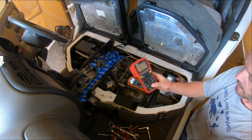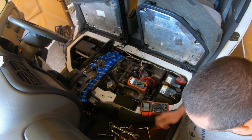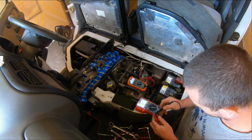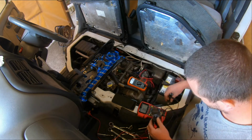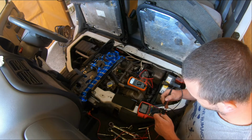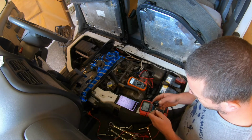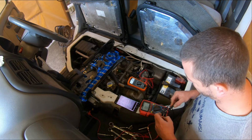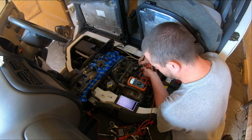Right, here's another multimeter. We will plug in some cords to it. So we need to verify that this thing works. Yep, 0 ohms, right. So let's check this one. Nothing. Right, so 37 to 41 ohms at 20 degrees. That says here. And I've got nothing on this one. Nothing at all. What have we got for the one in the car? I might have to buy one of these new and see if it actually...